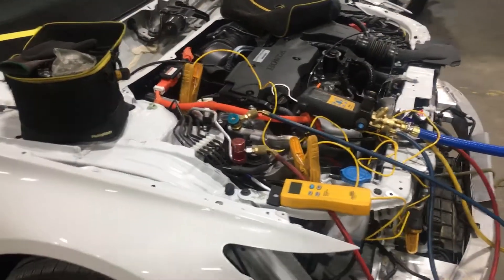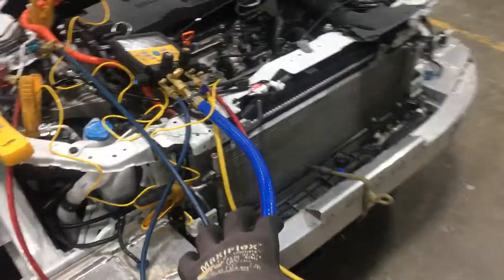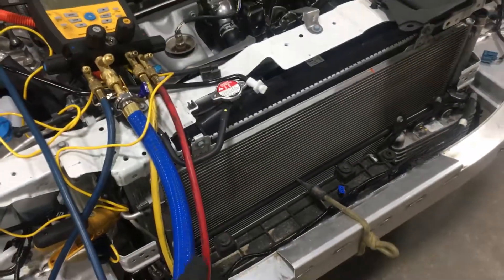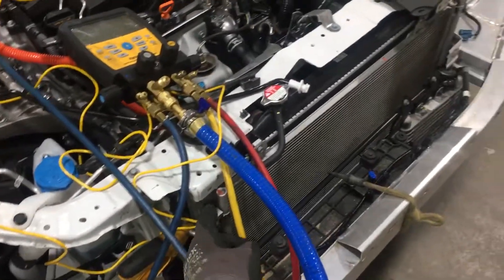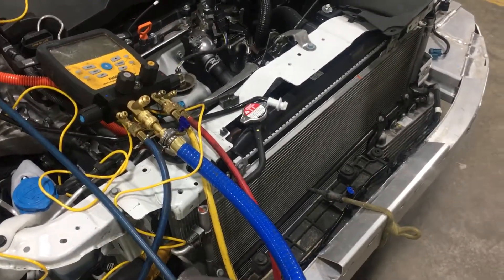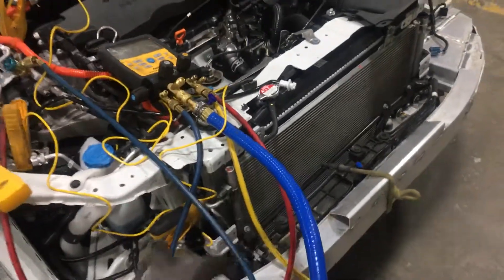I'll wait for part two of this video and we'll get the completion of this. Another thing — in this body shop we are doing an immediate removal and replacement of the condenser. These lines will not be exposed to the atmosphere because as soon as they crack these lines off, the condenser is coming off and the brand new one is going right back on, and I'm going right on the vacuum pump.